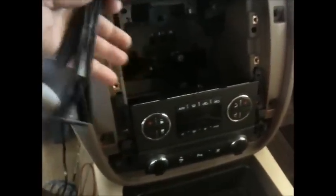Tiny. You guys really need to be careful. I use some special panel pullers from Snap-on, and I'm able to tuck up under there into the corners and evenly apply pressure. With our fingers and hands, with this thin of material, you can actually snap it and break it very easily. It won't take that much at all. Just be very careful. The clips are super good clips, they stay on there very well. So just go all the way around. There's clips all the way around on this right here.